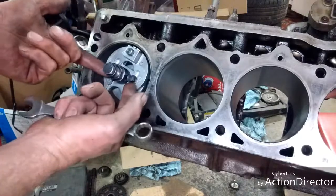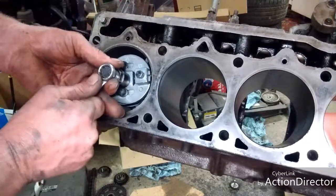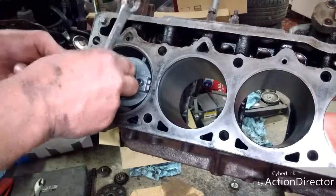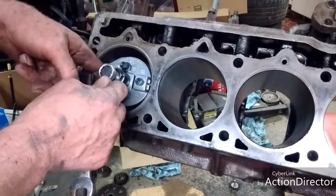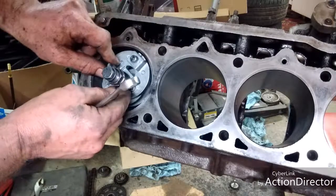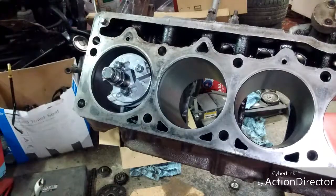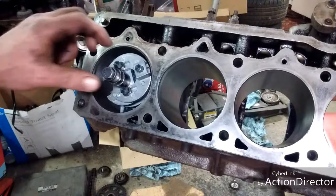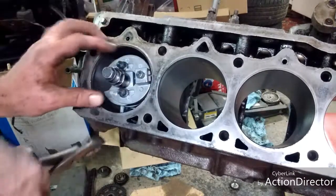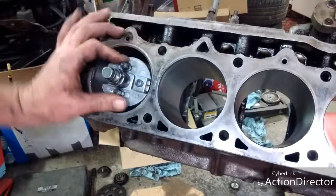These two here adjust the height to the cylinder, but I already got it set so I'm not going to loosen that. It looks like it slipped down on me — I didn't tighten it up enough. Okay, there we go. You just don't want to over-tighten these, so I was trying to be careful because you can damage your cylinder wall. Get that a little bit tighter. Make sure this thing here is in the number one position. Once you get it in place, just crank it over to the number two position. This one's being a little stubborn — there we go. You can feel it stop, so it's hitting.